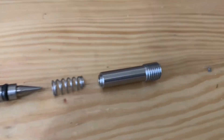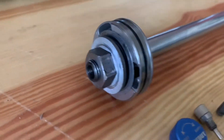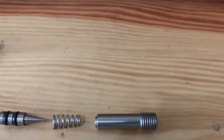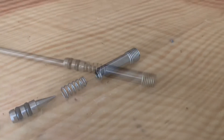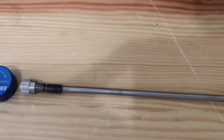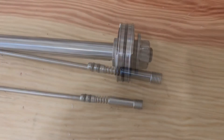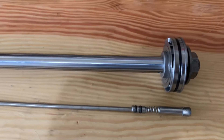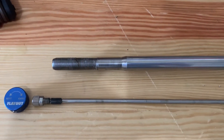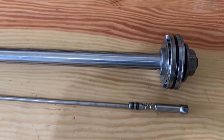This piece here at the very bottom threads in below the piston right here. So oil actually travels in here and out here. This whole assembly goes like this. Here's the assembly laid next to the shock rod. All the stuff on the bottom is inside. This shock rod here is completely hollow to accept all of these parts.